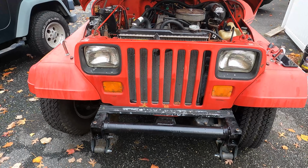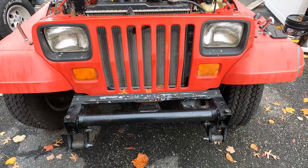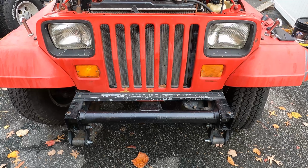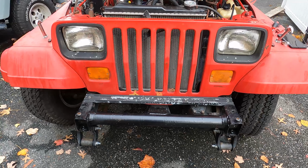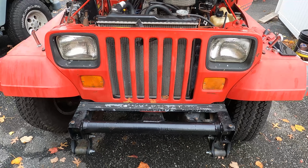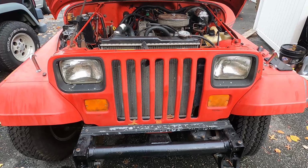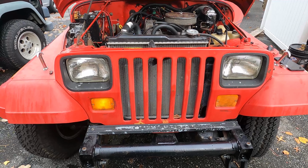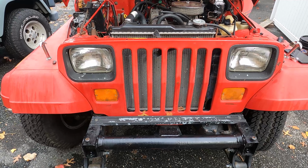I hope this video has helped you out. So with that, I think we have solved our issue. Very common problem, headlights on. There's some backfeed that goes on in the wiring harness. While I have the grounds off, I even had my windshield wipers start working, which makes you wonder where the voltage is going. So really you want to make sure your grounds are cleared up and clean, and then put them back on.